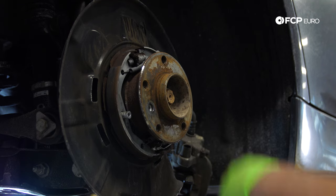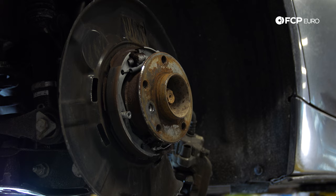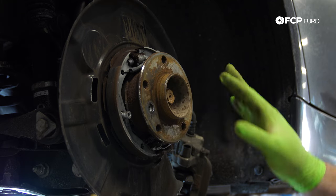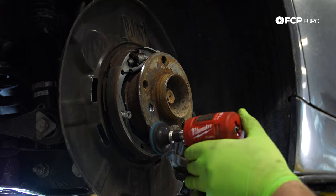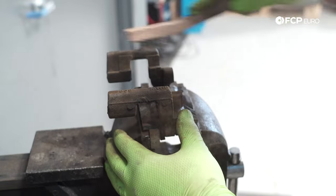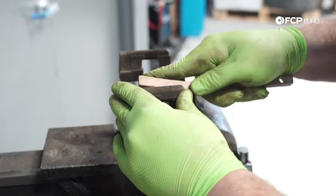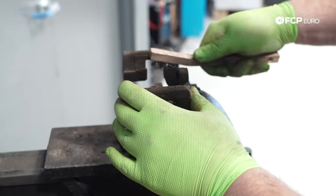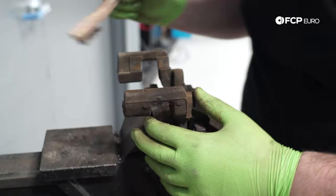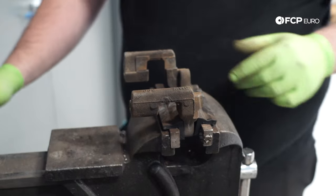Next, I'm going to clean the wheel hub. There's a little bit of surface corrosion here. You want to make sure this is knocked back so that the rotor will sit flush against the hub. I'm just using this die grinder, but if you have some sandpaper at home or some kind of abrasive, you can do this by hand or use a wire wheel on a drill — a bunch of different ways, but you just want to knock this stuff back as much as possible. Just using a wire brush here to clean some of the loose material off the brake caliper. You want to make sure these are clean and that there's no buildup of old brake material, because it could cause the pads not to properly slide on the carrier.